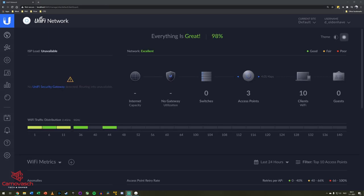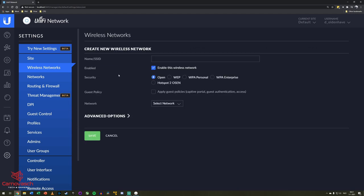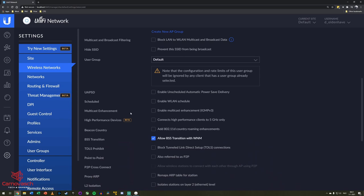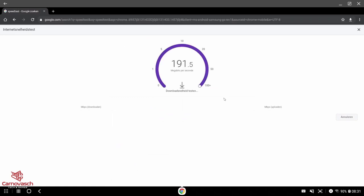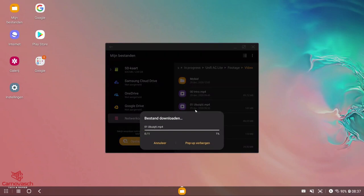If this is your first access point, you can now set up a WiFi network yourself. Simply go to the settings and the wireless network section, where you can create your own WiFi network. I advise using both the 2.4GHz and 5GHz bands, which allows the same WiFi network to provision on both bands without the need for two separate networks. There are a lot of options including a guest portal. To test the WiFi connection, I ran two internet speed tests and reached the max speed of my internet connection. Copying files from the network also goes very well.